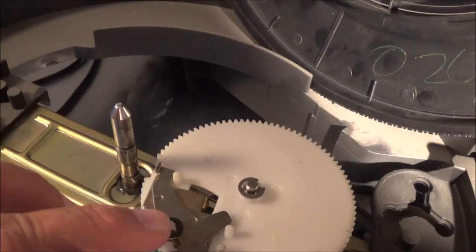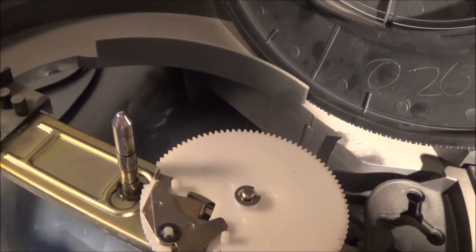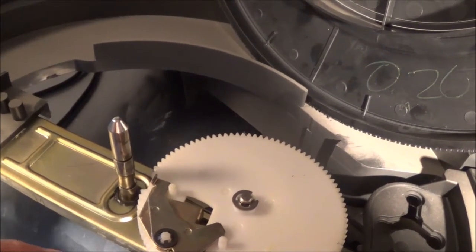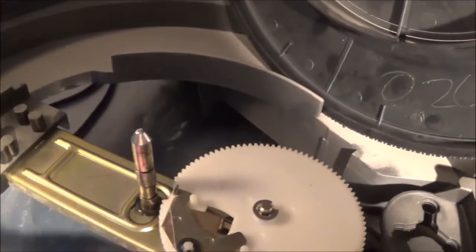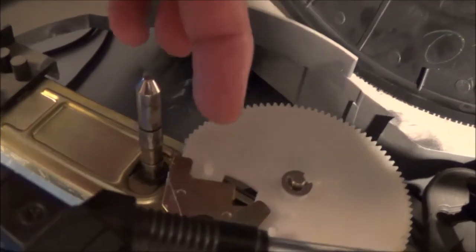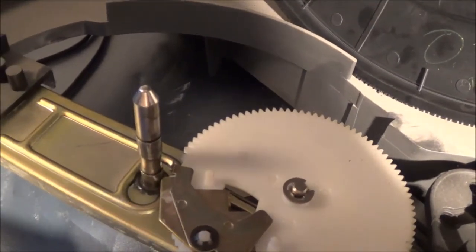From the top I just decided to pull this apart. It's got two trip levers on there. Remember that black arm pushes on the bottom here as the tone arm follows the grooves from the outside in until it reaches the final groove — the run-out groove. Underneath here, that moves closer and closer until this lever can finally catch that tooth. Doing this by hand, it should start to move pretty soon. Right there — you can see it moving, and that would be far enough to catch it and start the shutoff process.